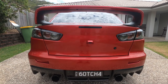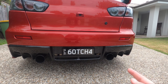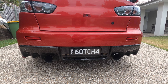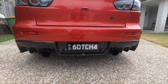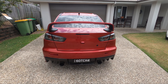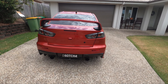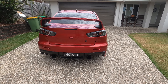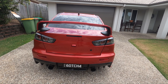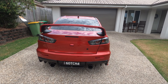We had to do some minor modifications: the number plate bracket holes weren't big enough so we drilled those out, and the brackets underneath that clip to the chassis weren't quite the right size or spot, so a little bit of bending and using bolts instead of clips. This diffuser is from Carbonetics - I'll have a link in the description. A little disappointing that it doesn't just mount up - you have to Sikaflex the screw anchor points and Sikaflex the corners - but the fitment is great; it's just getting it to fit that's the issue.